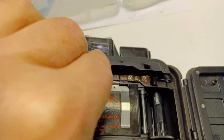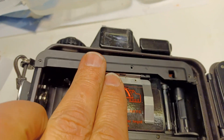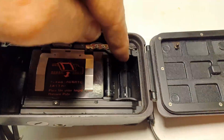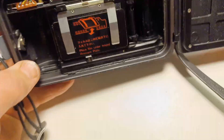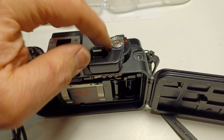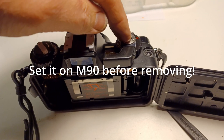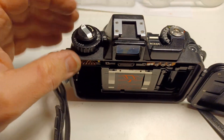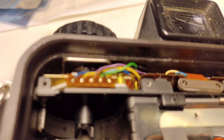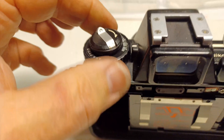First thing you have to take off is this little piece here with four screws. Then there's one screw there and two screws in the bottom. But before you can lift this piece out you have to take away this and this — there's one screw on the top and then you just lift it up. There are three o-rings inside. This one has a little thing that holds it, so once that is off you just pull this off and lift this one straight up.